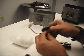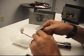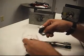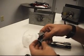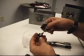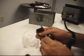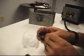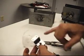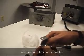There's a nut on there. I'm extracting it. We're going to drop the potentiometer down and out, and I'll just place the new one in. If I look, this one came with a lock nut washer and everything as well, so gotta take it off. So now put it in at the bottom. There's a hole to line up. There's a positioning pin on the side of the potentiometer. Make sure that's lined back up with the hole.